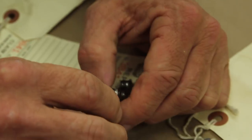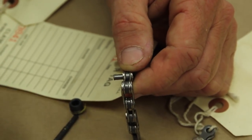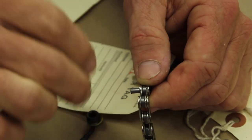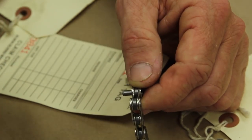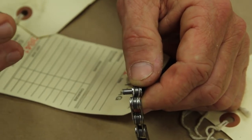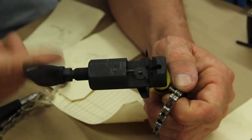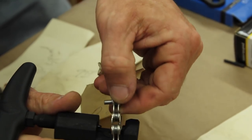If you're going to put it back together then you've got to be careful. If you're using a Shimano chain — these are all KMC chains — but if you use a Shimano chain you've got to use the specific chain tool pin. Very, very important. Safety takes no holiday. Usually nowadays we're using quick links — you're really only using the chain tool to make the chain shorter, then you use the quick links after that. But if you have to put the chain back together, it would be nice if I'd left a little nubule on there.